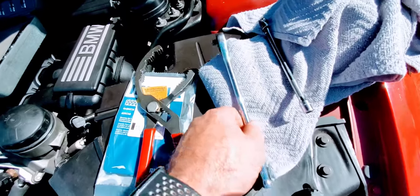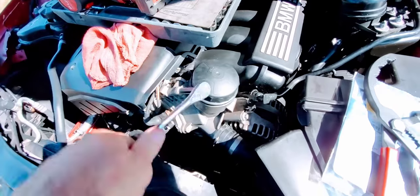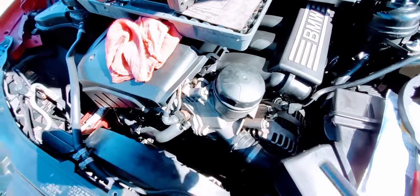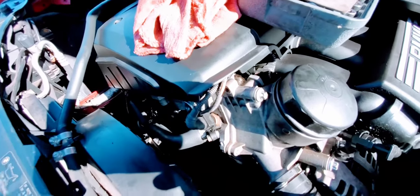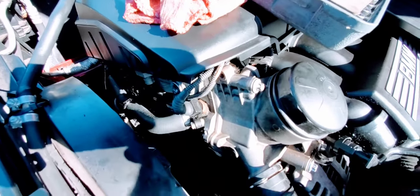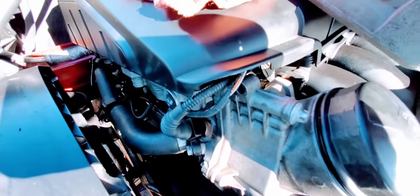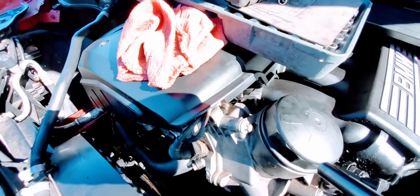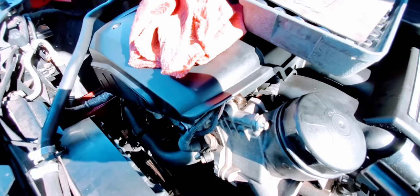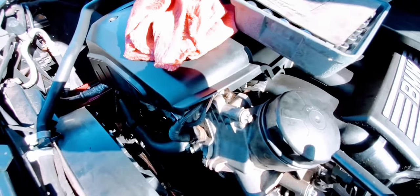We have the wobble already set up here, along with a nice long quarter-inch drive ratchet. They do recommend replacing these three bolts — I called BMW, they didn't have it in stock so we ordered them. They're around 10 to 15 dollars, very inexpensive. They're aluminum bolts so over time they stretch — BMW does not recommend reusing them, but if you don't have any you've got to make do.